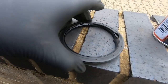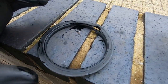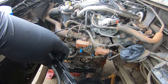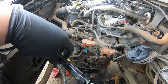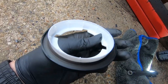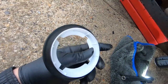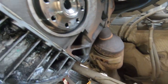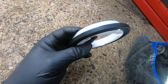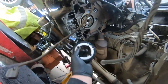So this is what the engine currently looks like — the rear main seal sits around the crankshaft there. There's a bunch of oil and residue down there. I want this area to be as clean as possible so we don't contaminate the new seal. I'm going to give it a really good squirt with brake cleaner, give it a little scrub with a brush, and try to make it as clean as I can, then we'll change the seal out.